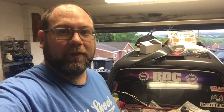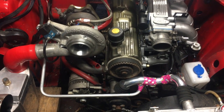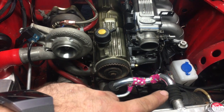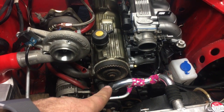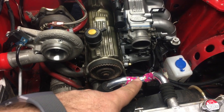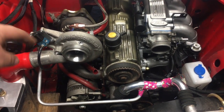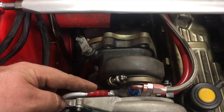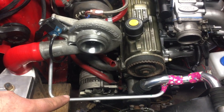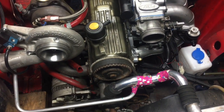After work tonight did a little bit more work on some plumbing - a rework of the top rad hose setup. Really pleased with how it's coming out. It's all mocked up currently out of ally bends. Comes out the thermostat, just slightly more than 90 degrees, dips down below where the charge pipe is going to go, then up and 90 into the rad, then new hard pipe from there, 90 and down with a little clearance bend underneath the turbo, then 90 straight across.